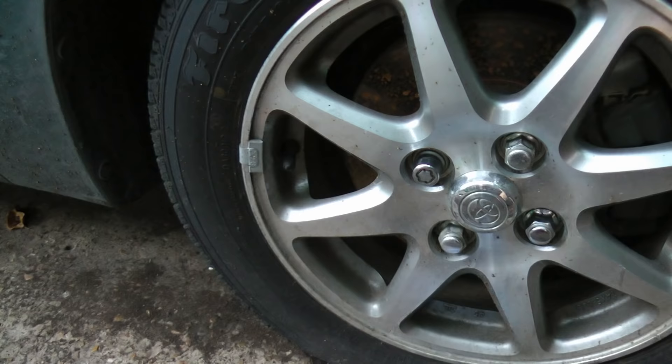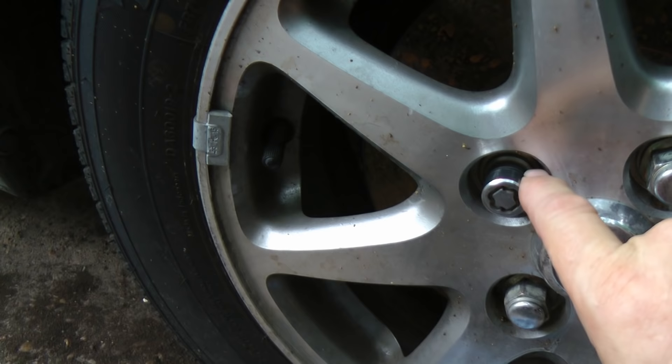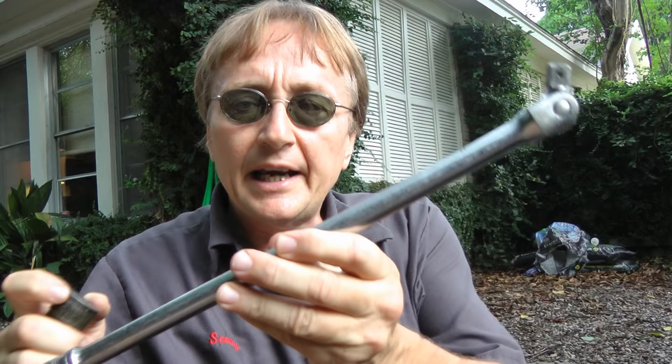But if you notice, this has one of these locking wheels so people can't steal the tire. And unfortunately, the key that unlocks it is nowhere to be found. So here's something that I use all the time — it's a wheel lock remover tool. It's got reverse thread, so when you turn it to go off, it bites in and pulls the lock off. I just bought mine online. Just google 'wheel lock removal sockets' and you get a set of three that will fit most cars. And they're real easy to use.